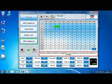Sure enough, the new feature is that if we are driving and for some reason we change a little bit the RPM or engine load, the petrol bar will turn red to warn us that we lost our previous reference and we are suggested to go back to petrol for a little bit to acquire a new reference and then switch once more to gas to check the mixture.